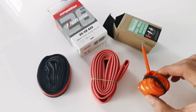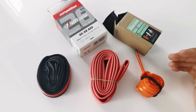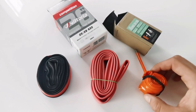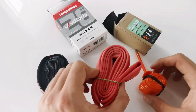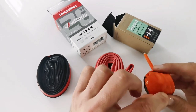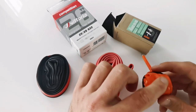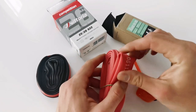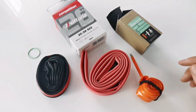You might think: why is that? Rolling resistance is the result of two factors. First, of course, rotational weight, which in Tubulito's case is the smallest. But it's also dependent on the friction between tire and inner tube. Because the Tubulito inner tube is made from a plastic material and it's a bit sleek, the lower weight is compensated by the material type. It's not as grippy as the latex mixture used in Vittoria Competition inner tubes.